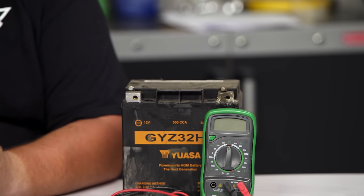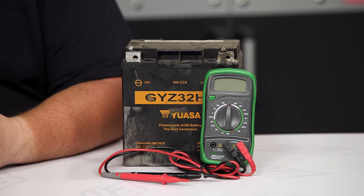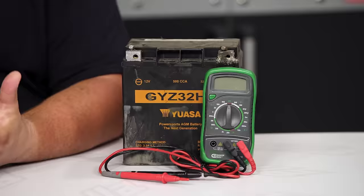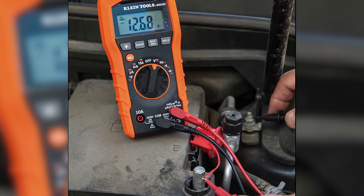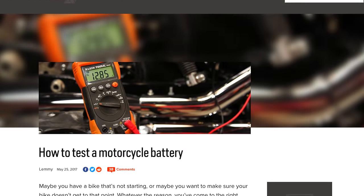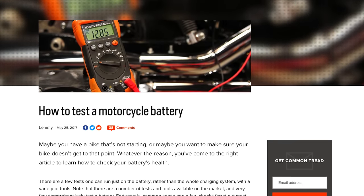The second thing I would also recommend you do is, as soon as it's practical, get that motorcycle home and check out the health of the battery. Test your battery. Make sure that thing is okay. The reason I say this is smaller batteries, like the ones found in powersports equipment and motorcycles, don't really take kindly to being discharged fully. If for whatever reason you've discharged your battery — whether it's a bad stator, or perhaps you just left a headlight or your key on — make sure you check out the health of that battery. If you don't know how to do that, we've got some Common Tread articles that can walk you through the process. You want to find out about a bad battery before it strands you again.